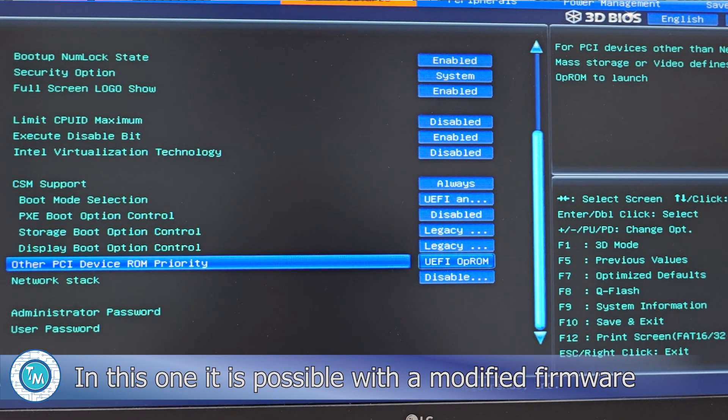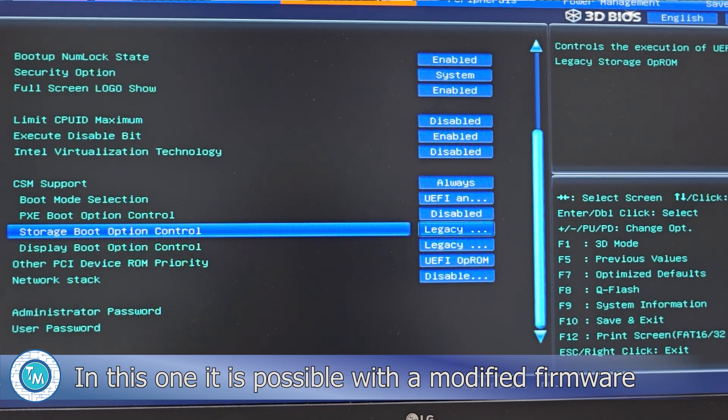In a nutshell, you will get a very reliable port when you buy one of these. I did not have to do anything to my previously used NVMe drive that I installed here to access its data. I've seen some people argue that other adapters forced them to format the drive before being able to read it — I wouldn't find any logical explanation for that. As for booting from this adapter, it depends on whether your motherboard BIOS can boot from PCI Express add-on devices. Most good boards will. So you can get a real upgrade — for file servers, data backup servers, systems used to clone other drives — you name it.